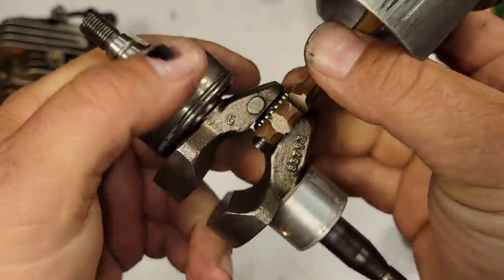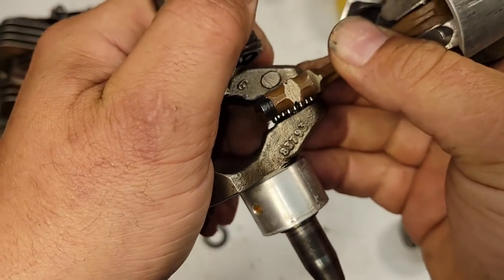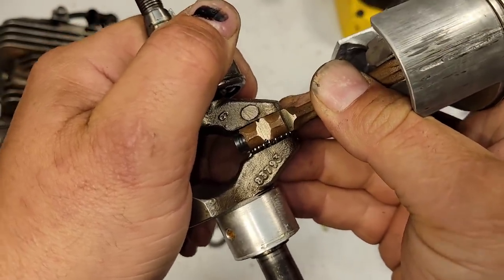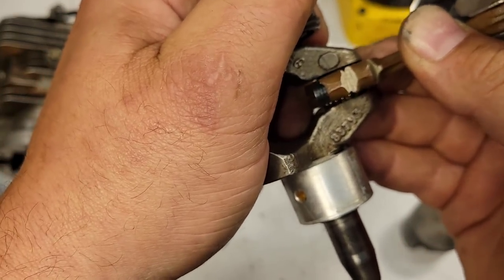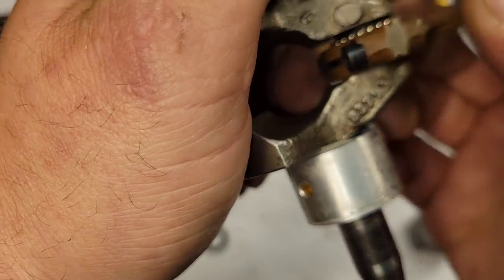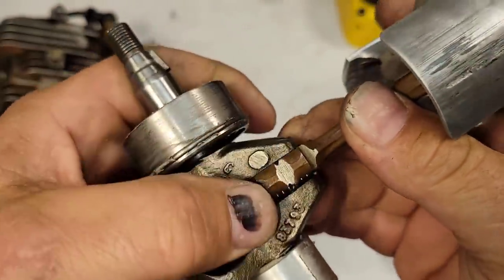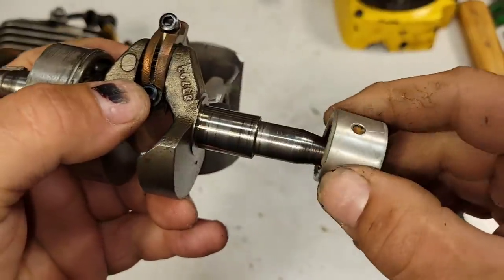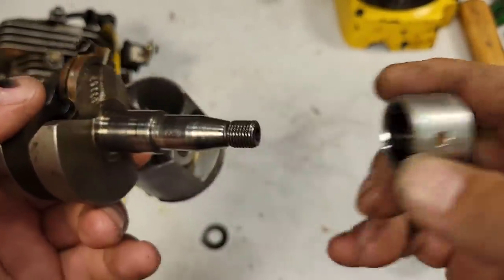Okay, this is that bottom end we built. No up and down play, really. These have a little shim sham. That's normal, side to side. These saws will have the slightest up and down play. That's just how they are. Loose bearings like this tend to, as the bearings get hotter and everything, that play comes out. Okay. Bearing, completely fine.